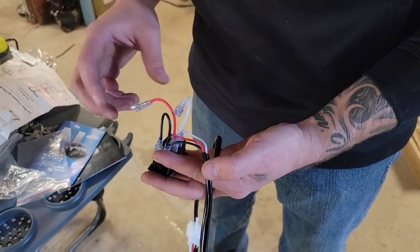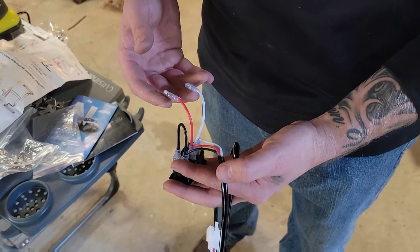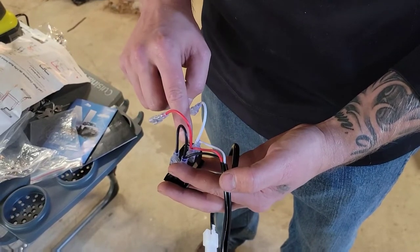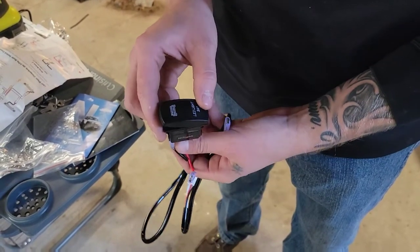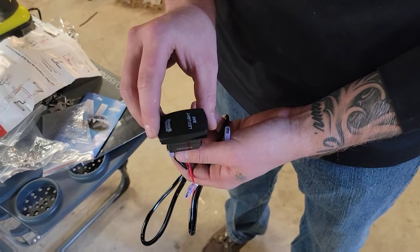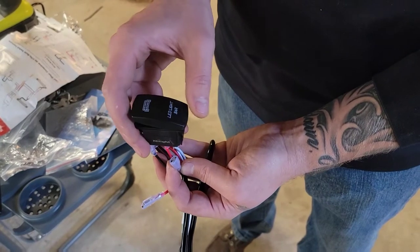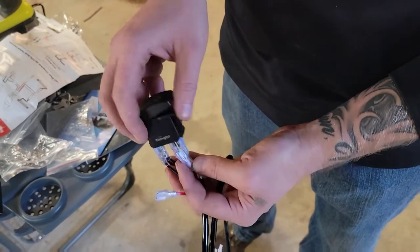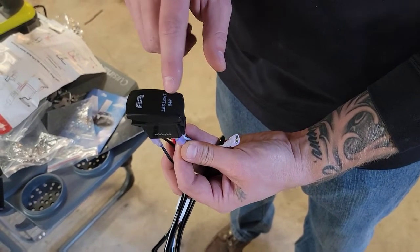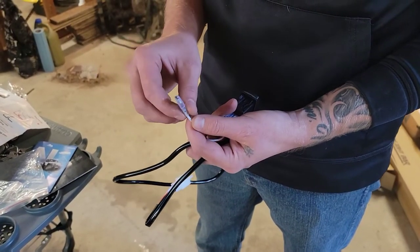There are two different methods for wiring this switch up. It comes pretty much preset, but you have a couple of options with your two leads. Your first option — which is what we're going with — is to connect the red wire to this tab. What that's going to do is as soon as you turn your machine on, the LED light on the switch is going to light up, and when you switch it to on, the whole thing will light up. If you put the white wire on there, when you turn your machine on the switch won't light up at all. We want it lit up when you turn the machine on so you can see which switch it is when it's dark out. You'll also have one extra lead that you'll just need to tape off.